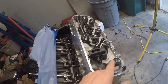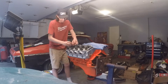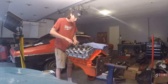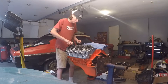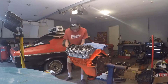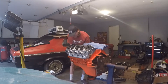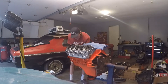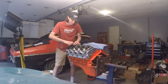Looking at it from the side, the roller should be slightly forward because as it rolls back it'll get more to the center of the valve — what matters more is the position during lift rather than how it's sitting at rest. Got my poly lock with the Allen key all the way out, seated on the lifter cup and the rocker. Run the poly lock all the way down just hand tight, feel it bottom out, grab the breaker bar, spin the motor over, watch it start to open the valve, then close the valve. Pull your poly lock off.